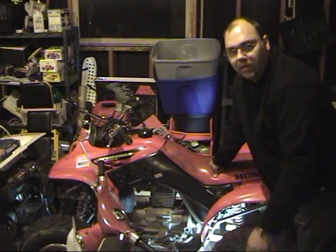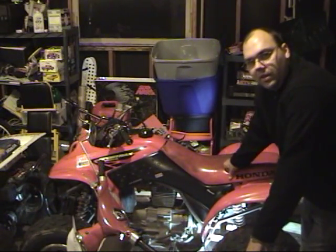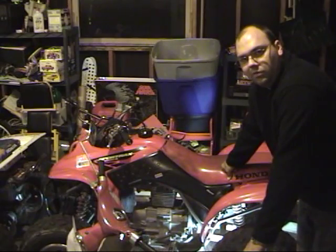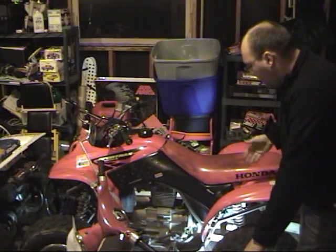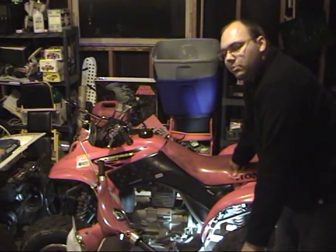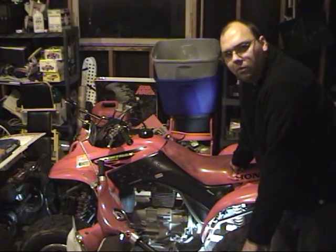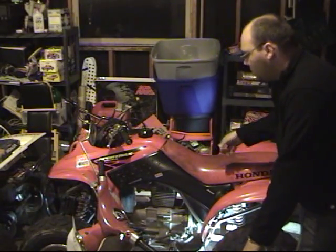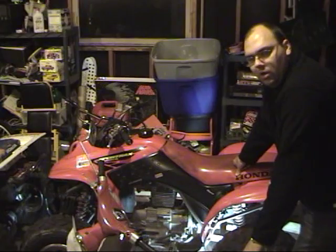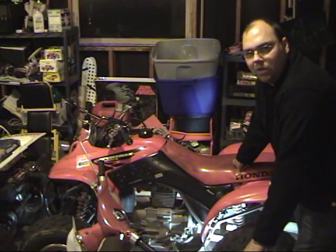So thanks for tuning in, guys. Hopefully this helped you 250EX guys out that are kind of searching for a cheap alternative to buying a Works package or something aftermarket that was very expensive. A front shock is an inexpensive alternative. I've also heard that the 300EX rear shock will work. I'm not sure how much softer it'll ride, because I'm assuming that this machine is a little bit lighter, so who knows, maybe it'll, but you probably have a little bit of adjustability on the 300EX shock as well.